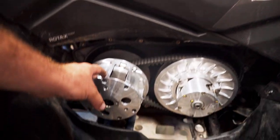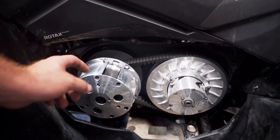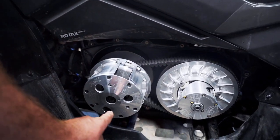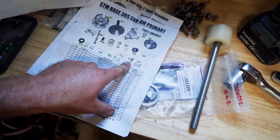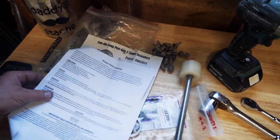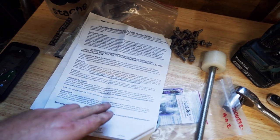To make adjustments on the STM-3RS — and I believe it's the same with the 3P, but you should check your manual — we need to remove this bolt and put the spreader tool in. Here, number 35, compression tool. Remember, always read the manual. It's really important. You don't want to mess anything up, especially on a clutch this expensive.